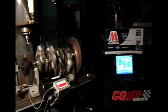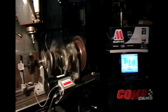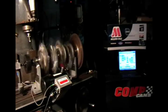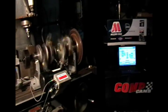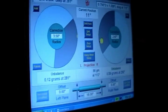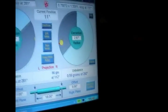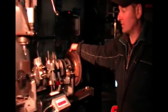Spinning this one at 650 RPM — it is an externally balanced engine, the 351. It spins up slowly to start with; it likes what it sees and goes to full speed. Okay, that's very good — I'm very pleased with that. 0.12 grams out at the front, which is well within tolerance, and 0.59 at the other end, so we're massively within tolerance. Very pleased. There we have it — a perfectly balanced crank ready to go back in the engine.